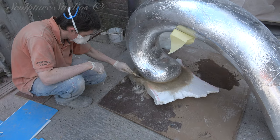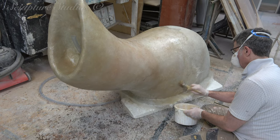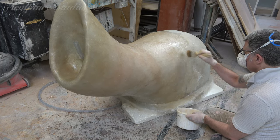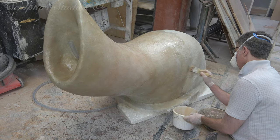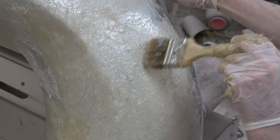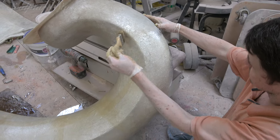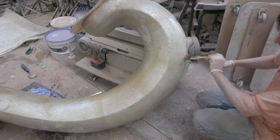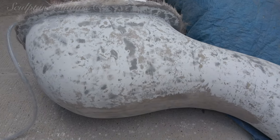This is just going to be a blanket coat as opposed to a mould, as this is literally a one-off production. We're going to be working up the surface with flow coats of resin and car body fillers, so ideally, it's best to get the fiberglass as smooth and neat as we possibly can at this stage. In order to fix this to either end of Betsy the caravan, we're creating exterior flanges with bolt holes for easy installation.